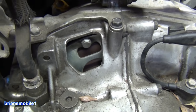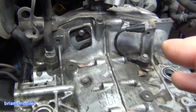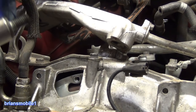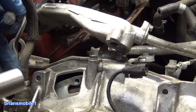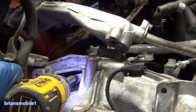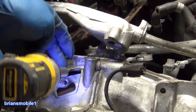You can see the rusty bit back in there — that is the torque converter. This part connecting it is the flex plate. The flex plate bolts to the engine, and the flex plate bolts to the torque converter. The torque converter slides over the input shaft. Pull off the inspection tray — a simple little easy step that saves you so much grief and expense of busting your torque converter.